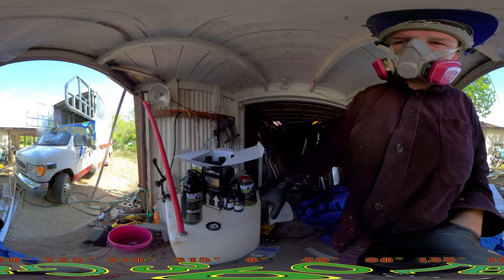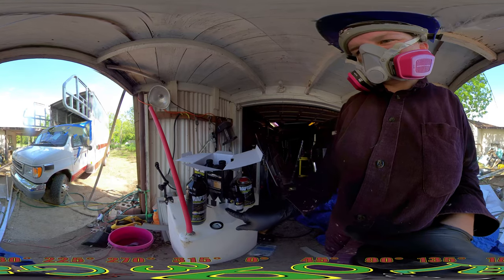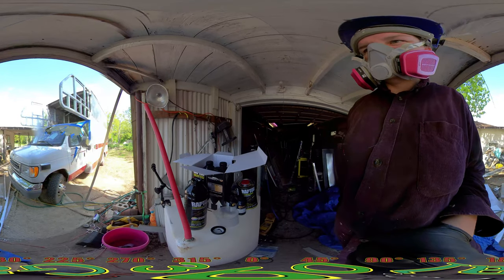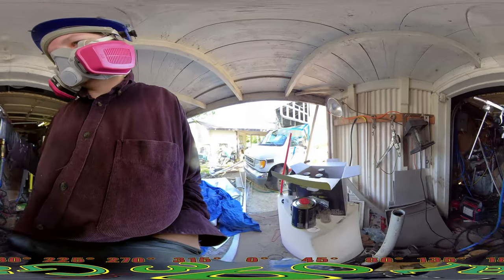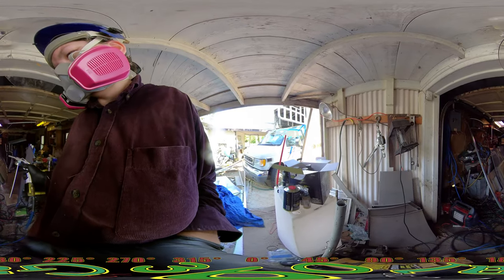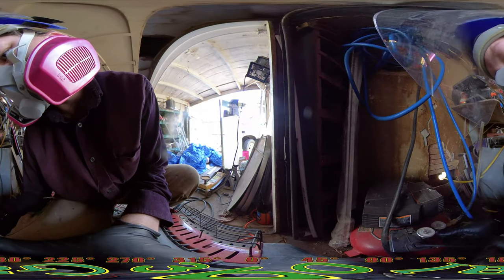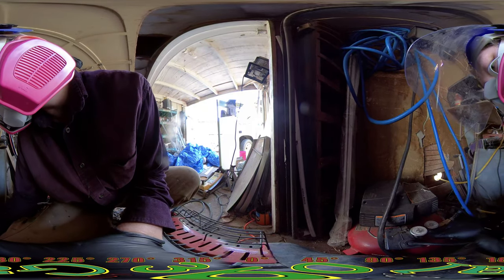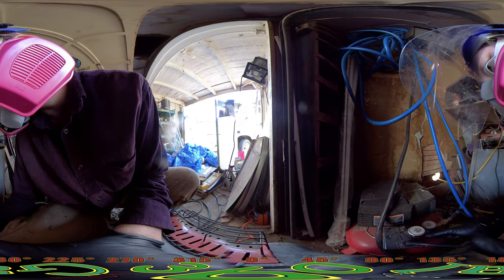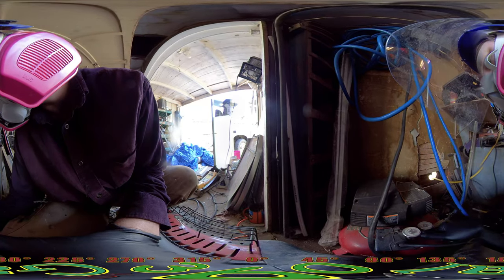And they say you have to mix the color, then the hardener in there together. It's 8 ounces, I believe, of hardener to 1 quart of product. And the spray gun can be adjusted. They recommend anywhere from like 25 up to 65. On the bottom I did about 70, and on the top of the cab I did about 80. It gives it a lot finer texture with 80. It doesn't have to be so rough. So I like that.